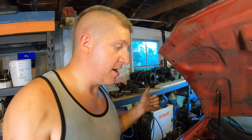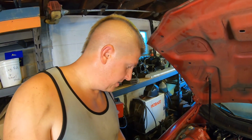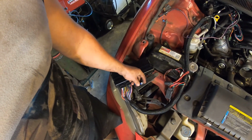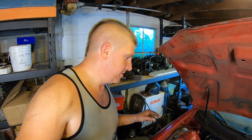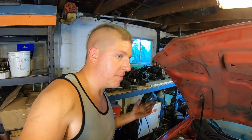So next thing I need to do is, well, first I had to order some parts. I ordered an air temperature sensor. I ordered some vacuum tubing. If you're not in a naturally aspirated or nitrous application, the instructions say you have to use the onboard MAP sensor, so I ordered some vacuum tubing for that. What else did I order? Oh, and a fuel pressure sensor. The wiring is there. I have the ports in my fuel pressure regulator. I figured I might as well have that going too. Not to mention that'll be important to have when I'm tuning this thing.